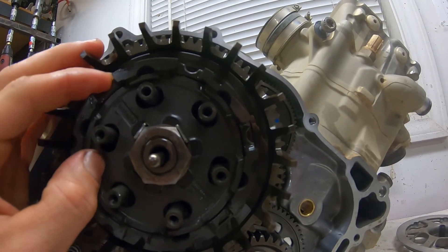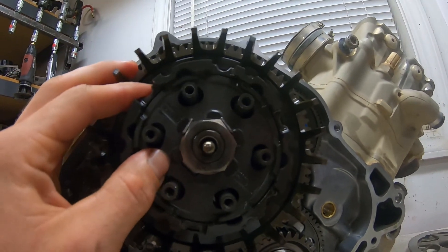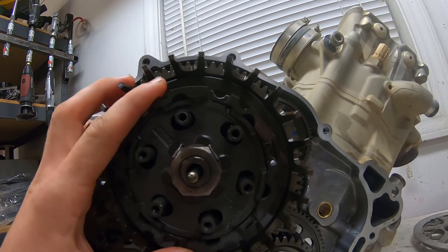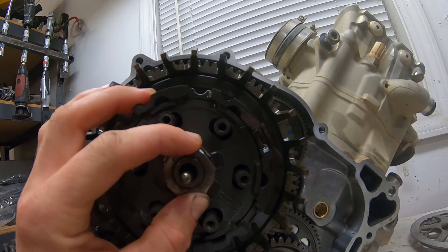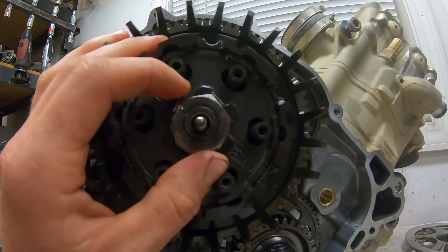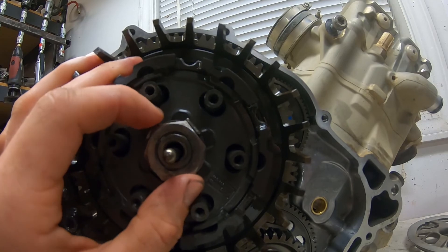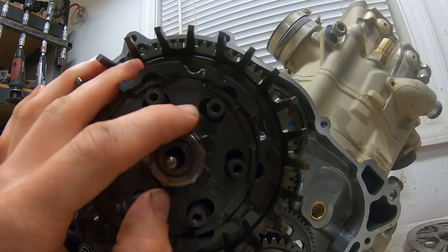So you've got a little bit of relative motion here. So the clutch — these outer teeth when the clutch is engaged, this drives the inner basket, and then the transmission is driven by this through shaft. But these rubber pieces — my engine always had this bad clutch rattle, especially when it was cold. Well, it turns out these rubber pucks can really wear. That's a huge amount of play to have in your clutch, and that's without even putting any force on it.